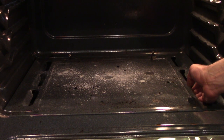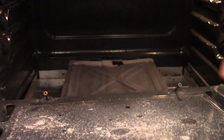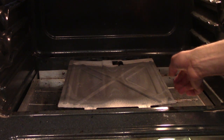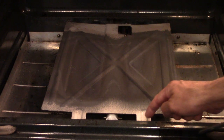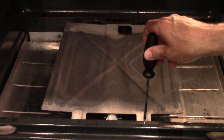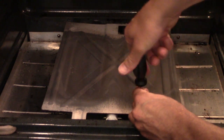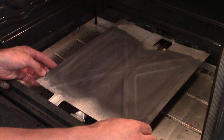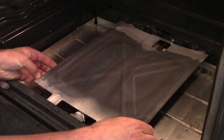Next, this lower pan — you undo these screws, you don't have to take the screws all the way out, just loosen them. Oh, this is still already kind of hot — almost like hot summer cement, except this is probably a lot hotter than that. I'm going to need a screwdriver. There are two screws right here to take out, and then we can remove this plate.